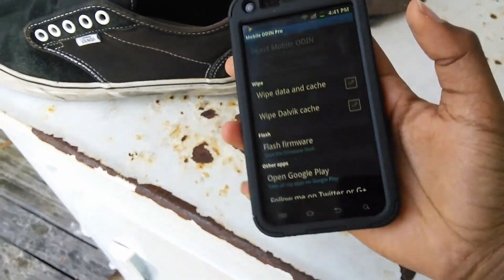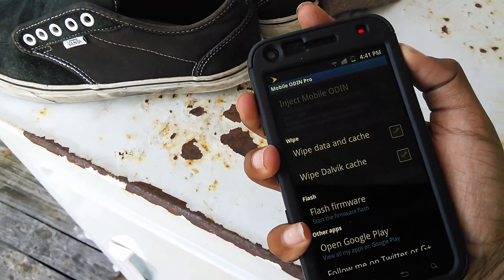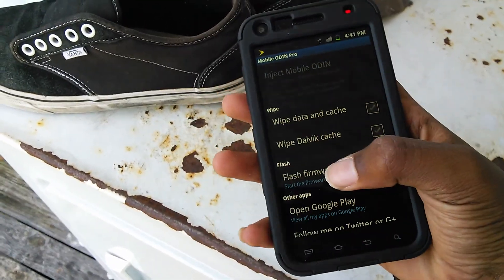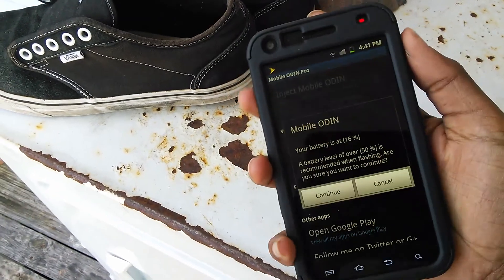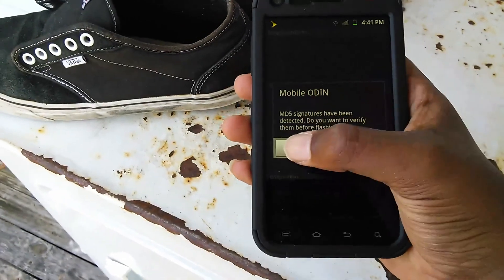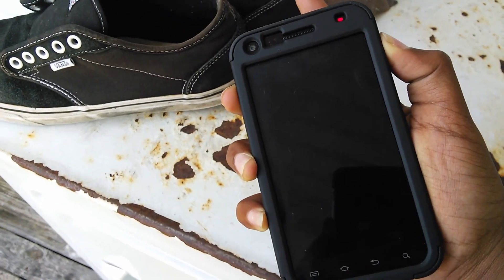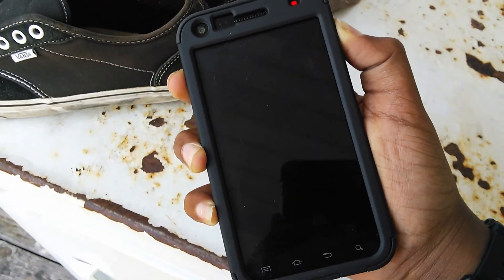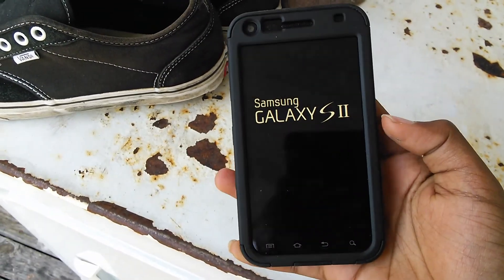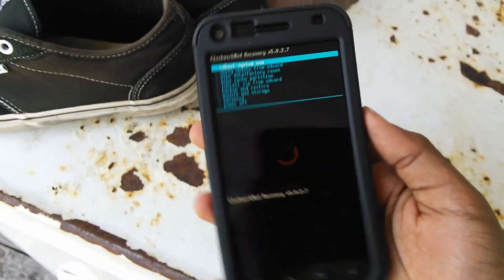All you have to do is click Firmware Flash. Prepare, because you're going to have to hold down the power button and the volume up button right after the firmware flash. As soon as it goes blank, hold those buttons down and you'll be good. This is the only tricky part about it. So click Firmware Flash and prepare — you will have to check some MD5 signatures, they don't take that long. And it's flashing — hold. And once you get to the Samsung screen, you're pretty much set. There's nothing really to worry about now. Once you get to that screen, you'll go ahead and boot into recovery and then start the first flash.